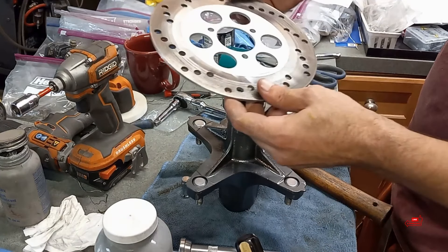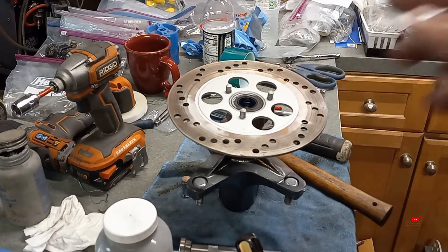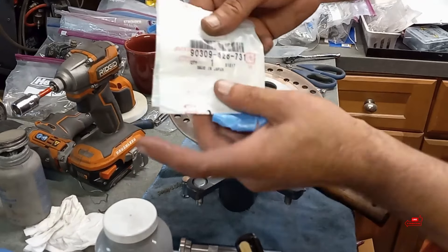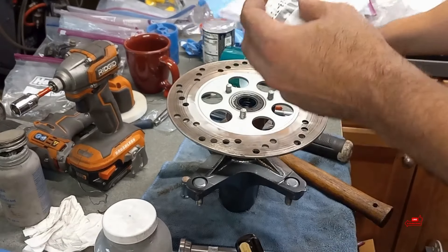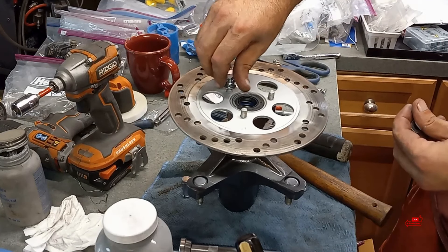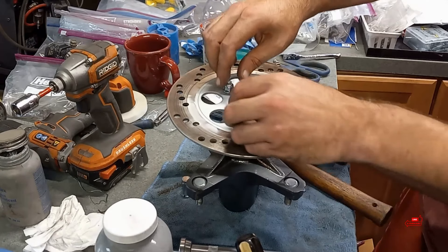Here's our rotor — this goes on the left side of the bike on the 350X. It's got a directional, so that's going to go right down there like that. Let me get out our brand new Honda nuts for those studs. Brand new OEM nuts — the part number is 90309-428-731. Just in case you were wondering and happened to need these nuts. Nothing like some fresh hardware — I'm going to snug these down by hand, just like that.